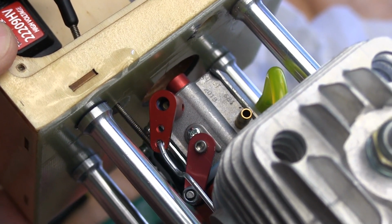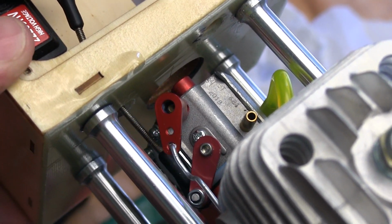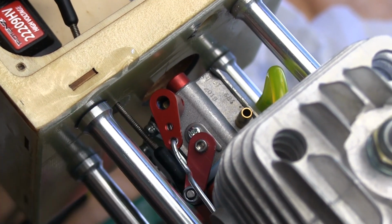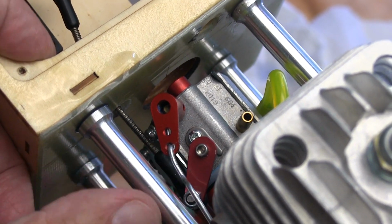One of the reasons I always use the soft steel rods for making my choke rods is that they're easy to form. From here I make little bends to make sure that the choke rod stays clear of everything and that it gets to the front of the motor where I need it. And while making those bends, we have to remember that we need to support this choke rod at some point, so we have to factor that in as well.